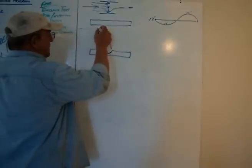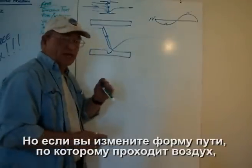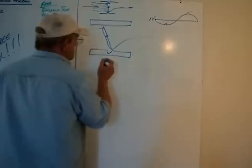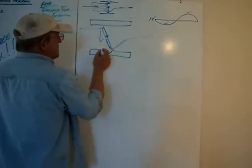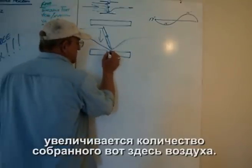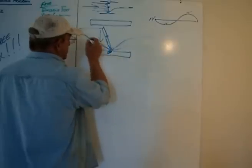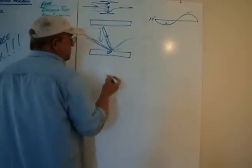As the air hits this plate, whatever hits here comes down. Whatever's closest to the center will become the intake air stream. But if you change the shape of a passage through which a fluid flows, you also change the behavior of the fluid. As the intake speeds up through this portion of the downstroke, the pressure here is building and increasing because the air speed puts a downward pressure onto the groove. What happens is it winds up splitting the intake air stream about in half. As the pressure increases, it increases the amount of air being gathered up. Above this line becomes part of the intake air stream. Below this line, it is compressed in a dramatic fashion into a little one-eighth inch groove — gathering 40 to 60% of the intake air stream. That little ledge will separate and gather this up. But there's more to it than just that.